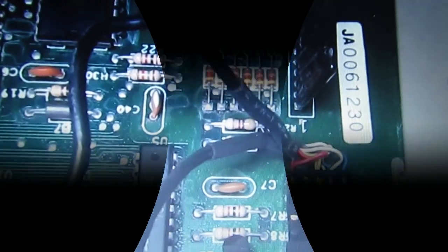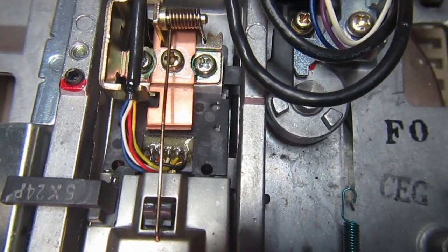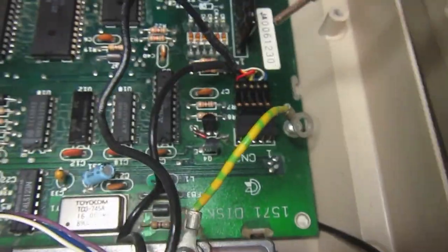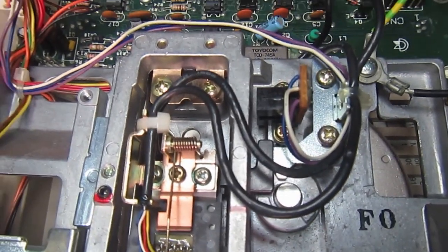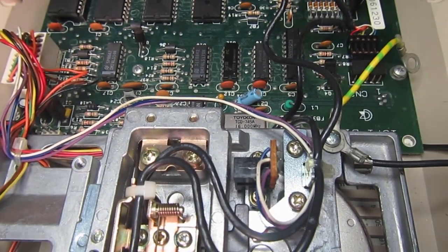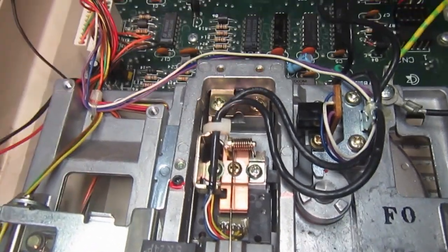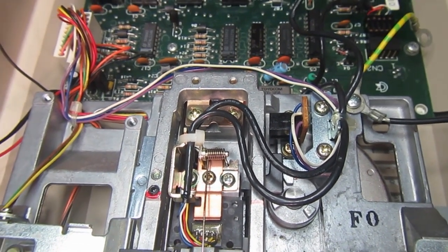If you don't see these readings, something is wrong with the read/write head or erase coils — as I found on this drive. Measuring directly on the connector contacts confirms it's not a wiring problem between the head and the PCB. So this 1571 will go as a parts unit, unless a good mechanics donor with working heads turns up. That's sad, but it happens. Thanks for watching.